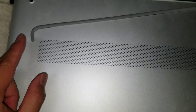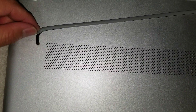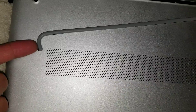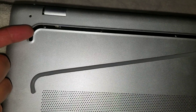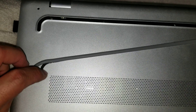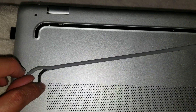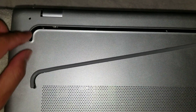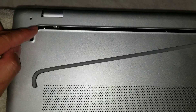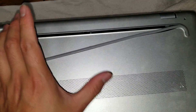Once you remove those, you'll want to peel up this. There's a black adhesive layer and then a rubber layer, so you'll have to use like a needle or something to scrape up and pull up both layers. It'll be a little difficult to put back. The black one's not really flexible or stretchy, so what you'll want to do is after you put the screws back, put this first and then start with the edge and push it in, because the middle will have to squeeze inwards since it stretches when you peel it out.